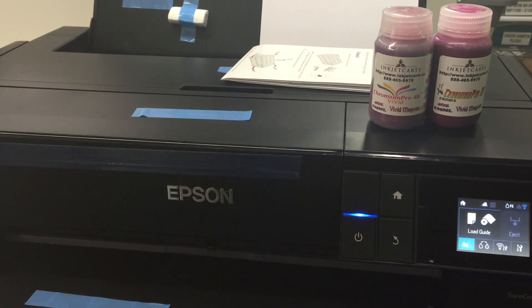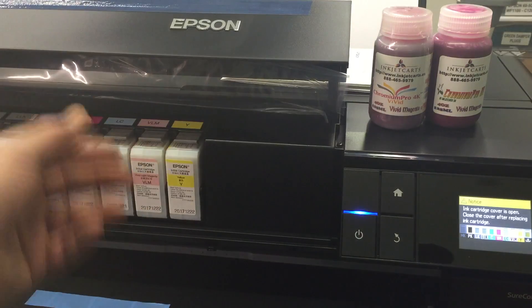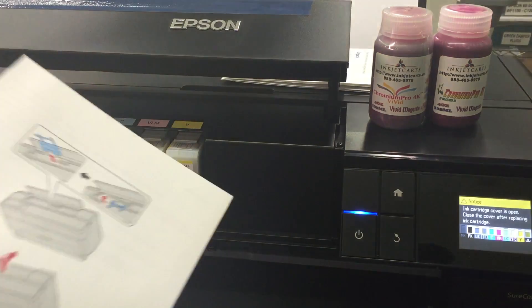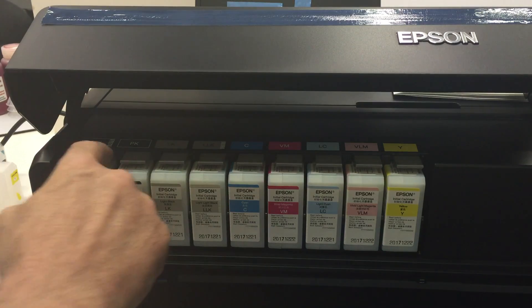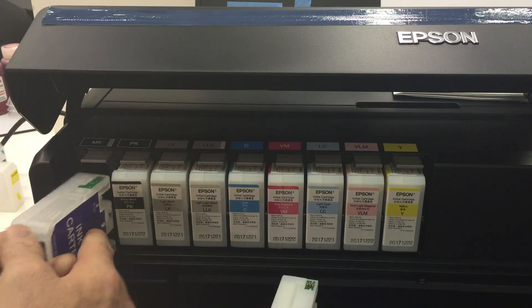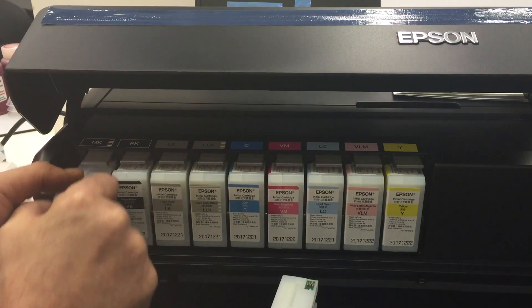I like one feature here. You can open the ink cover at any time you want and it'll unlock it and it even pops up. I guess we missed one piece of plastic during our commissioning. We did follow the start here card during installation and I recommend you do too. There is going to be a switch key over here on the left side of the ink bay to install if you go with the longer carts. But obviously, if you go with the short carts, the ink bay cover will close with those installed.